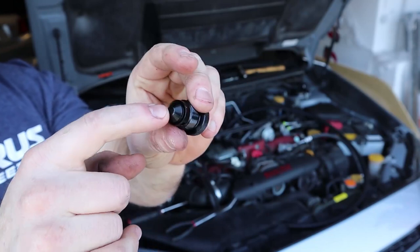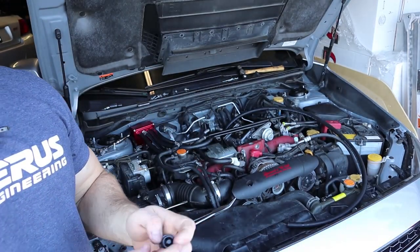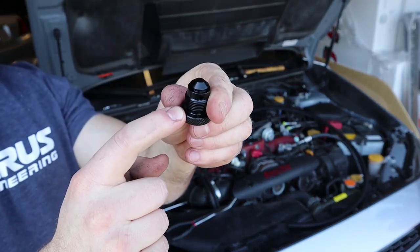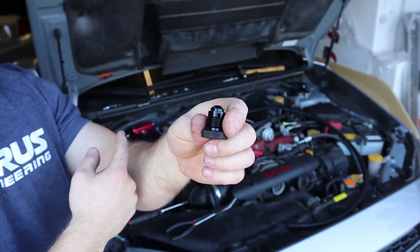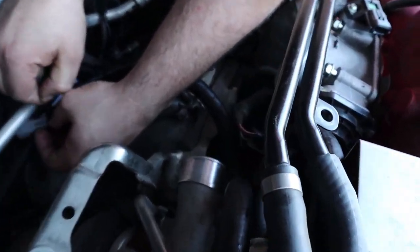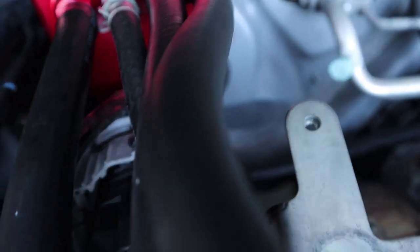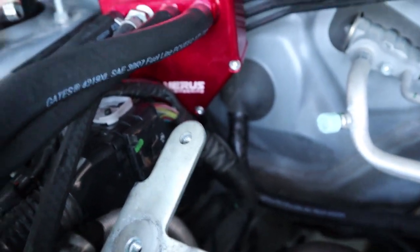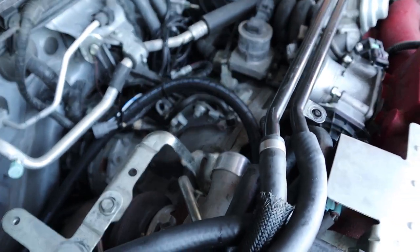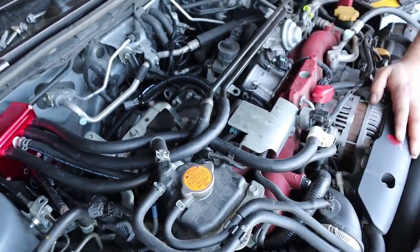For the drain back kit, uninstall the petcock unit — it generally has an O-ring. This is how the AOS is normally drained, but we have the same unit with a hole straight through it so it's always open. Reuse that O-ring. The new part has a half inch nipple on the bottom already. Replace the petcock with the auto drain-back unit, reinstall it into the bottom of the AOS, and run a hose to it. The drain hose runs along the firewall to the bottom of the air oil separator. As long as you keep it below the bottom third of the AOS, it will continue to drain.